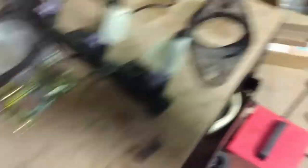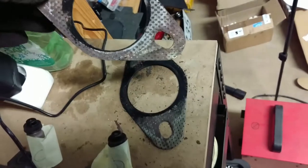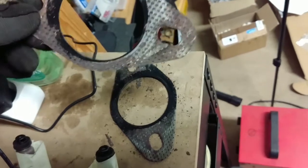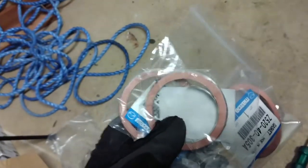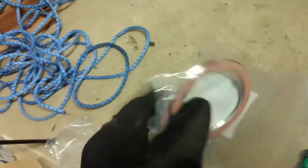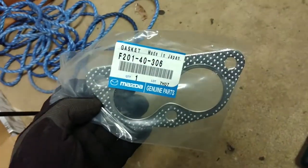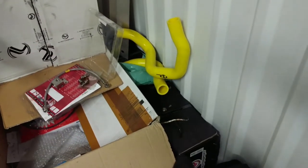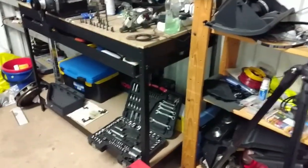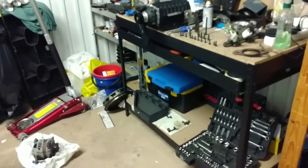If you remember I had an exhaust leak — here's probably why. Both of these are very sooty, so these gaskets did not manage to keep the exhaust tight. It was leaking a lot at both of these. What I did instead was go to Mazda and get original gaskets, which are much better for this car. I also have a new header to downpipe gasket. After that, it's actually only the radiator hoses, the radiator itself, and of course a ton of vacuum routing, which I'm actually rather scared of doing.